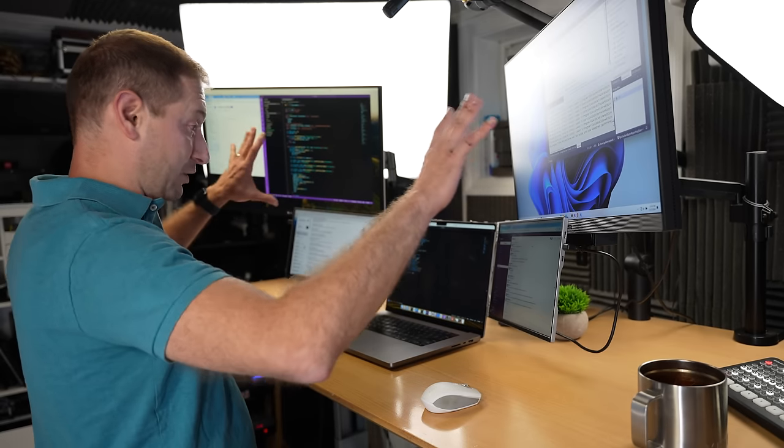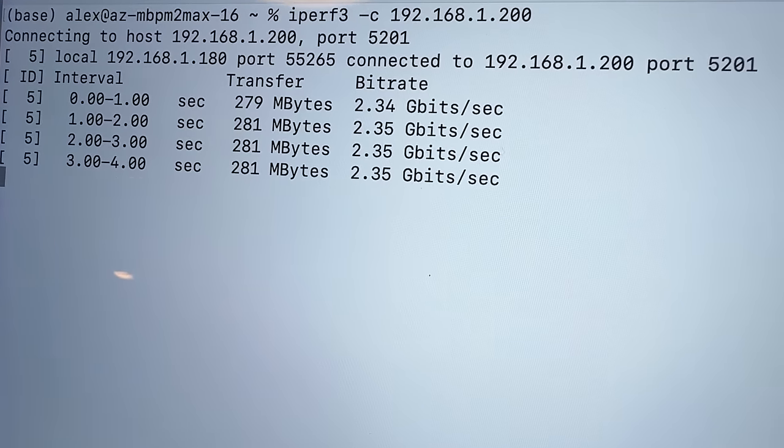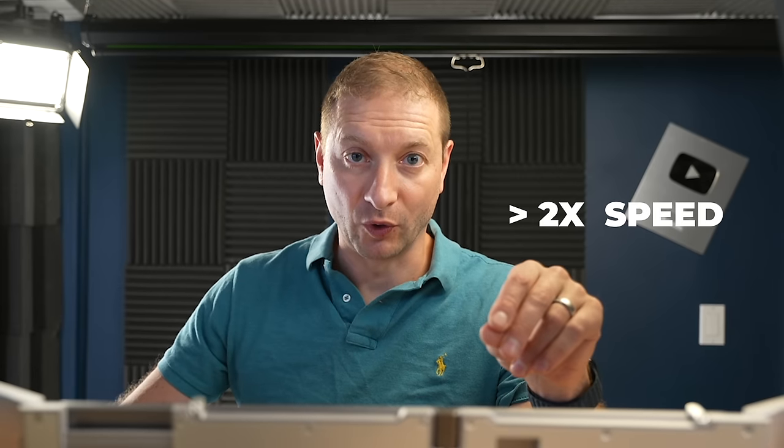Not only that, but I have multiple configuration options. I'm using all USB-C outputs right now for all four monitors — I've never had a dock where I could use four USB-C outputs. There's also HDMI outputs I'm not even using, and I have two more USB-C ports plus a bunch of USB-A ports still not in use. The biggest benefit I got was faster network connection from my computer all the way to my switch. My NAS is connected to my main switch, so now I'm getting close to 2.5 gigabit per second speed all the way to my NAS — more than double the speed I was getting before copying large files.